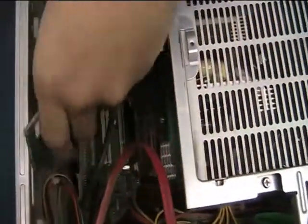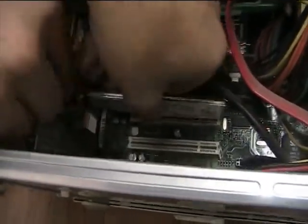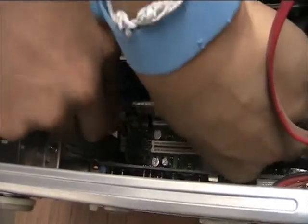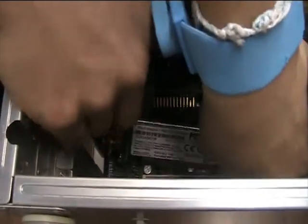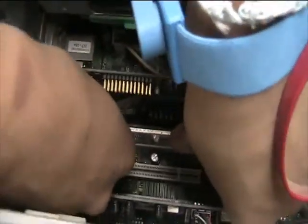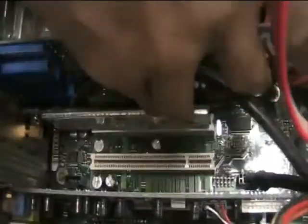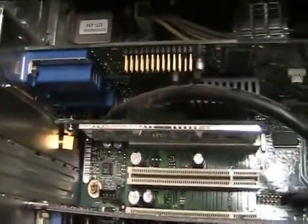You find the bridge and that bit connects to that bit. Find the wireless card, and like RAM installations you get your thumb, applying pressure with both thumbs — which can be tricky sometimes when you've got two PCIs being used at the same time. You should feel it go in, and that is as simple as that.